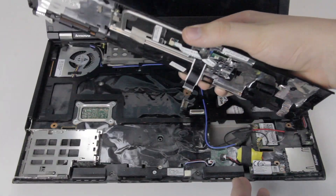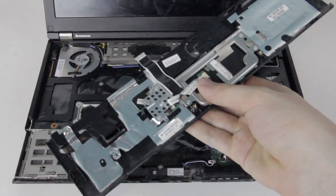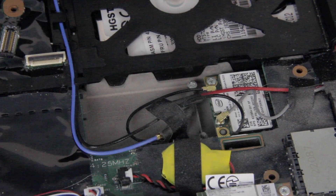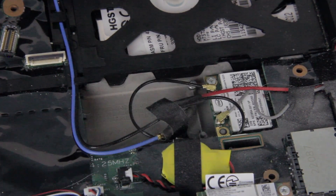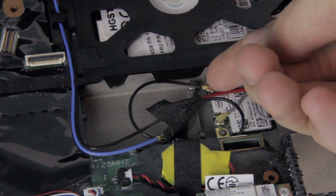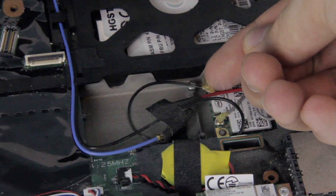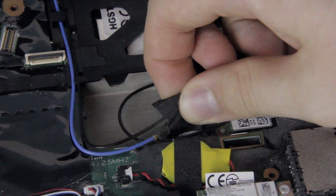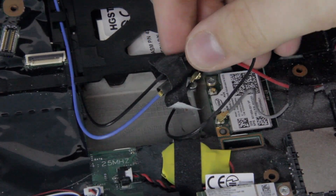Since you already disconnected the cable, you should now just be able to pick the palm rest up and lift it away. You should now see the empty mounting space to the right and towards the front of the computer. Before you can install your SSD, you're going to need to lift up on the black cable going into the wireless card and pop it up. Then lift the entire blue wire, including the black cable, away from the slot.